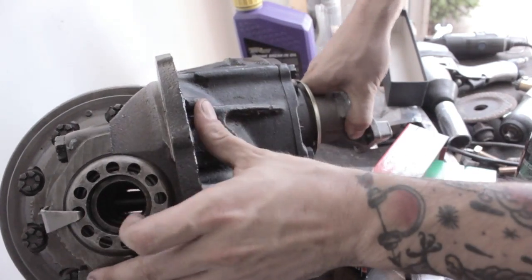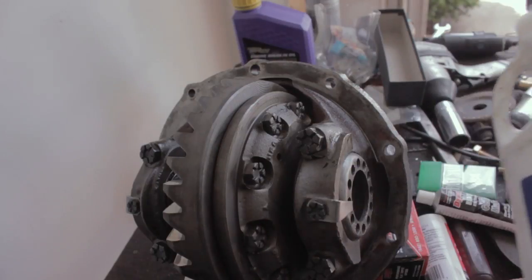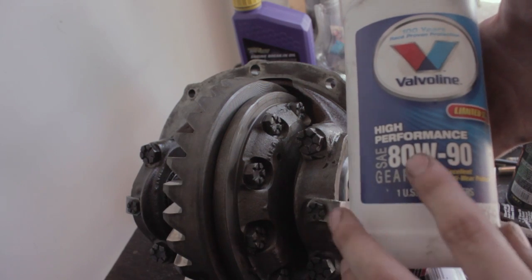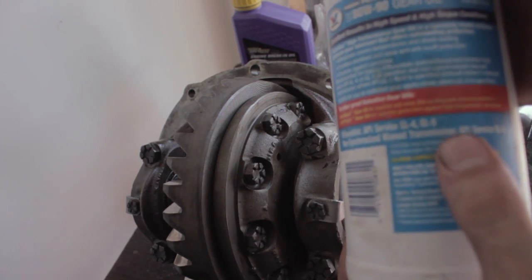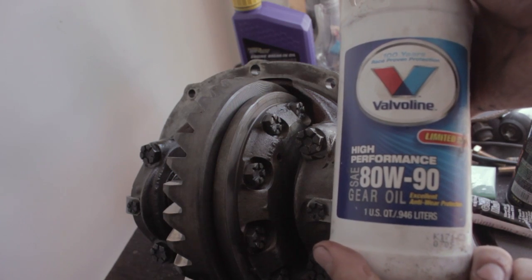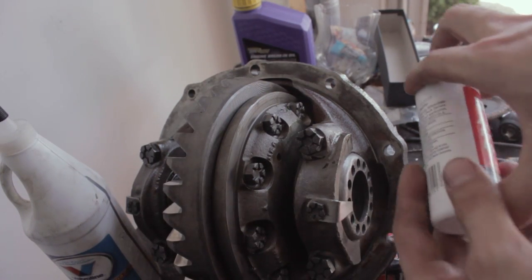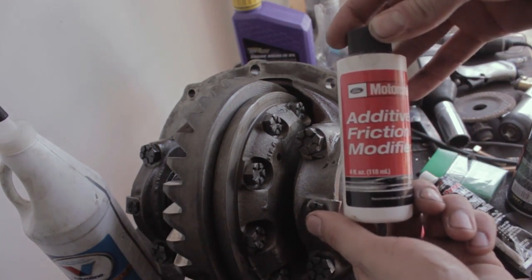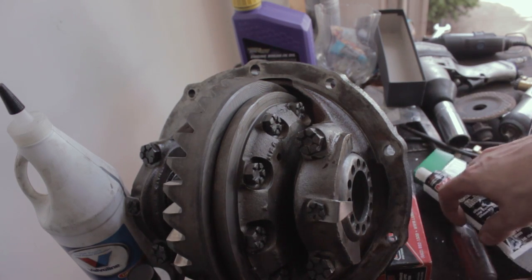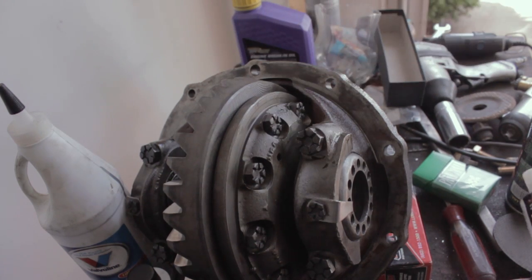This is what hooks to the drive shaft — when it spins, it spins that. So now we're going to be putting power to both wheels. You can see this turns this way inside and the other one will turn the same. This rear end is filled with gear oil. The guys at Custom Differential said to just put 80W90 in, which is what this is, with a GL5 rating. They said on something this old — the old Ford 9-inch — don't bother getting anything synthetic, you're just wasting money.